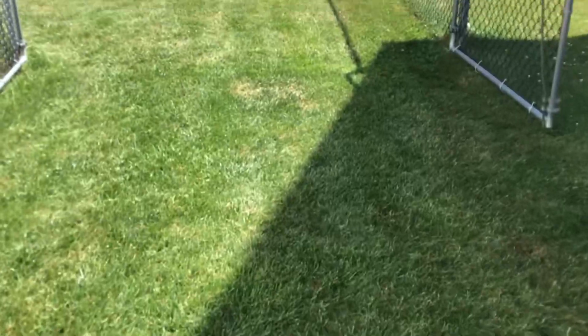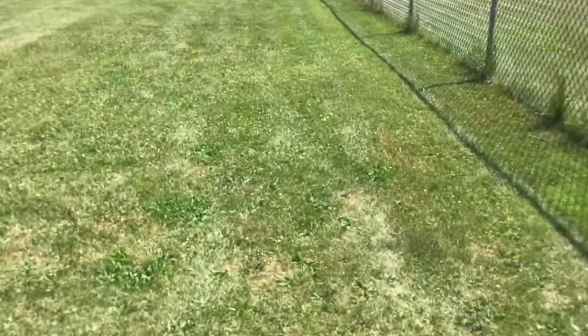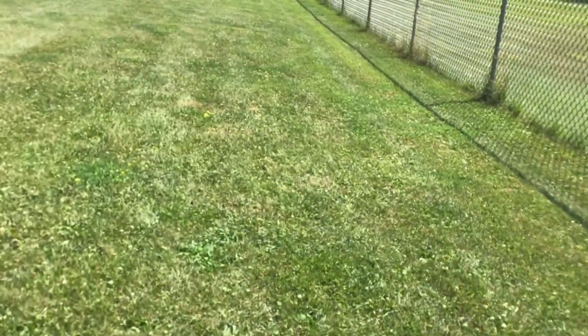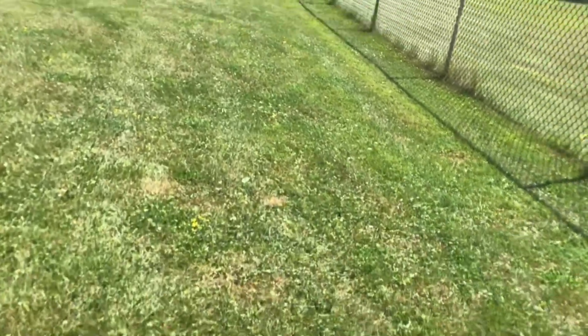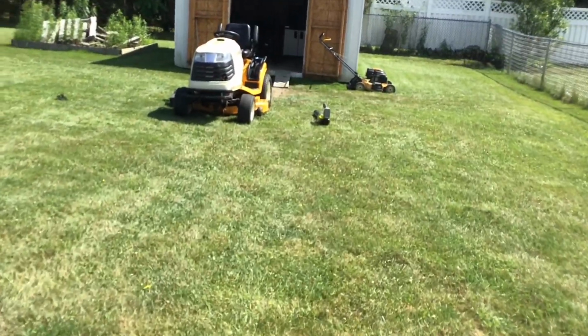Not as much of a fan of the idiot lights. I mean, I get they're there, but I really don't think a lot of people look at them, and I think that's a big issue. Obviously, on the new GSX, if you have an oil pressure issue and that stupid light came on, it's going to come on due to oil sentry. And I'm pretty sure they shut off the engine too. That's the whole point of them.